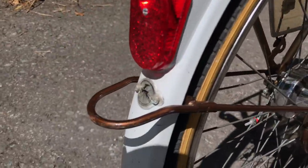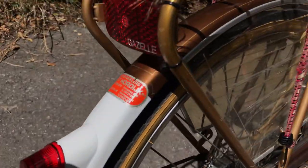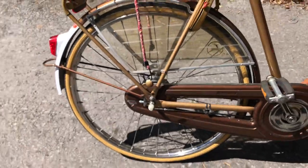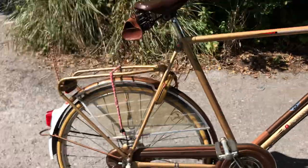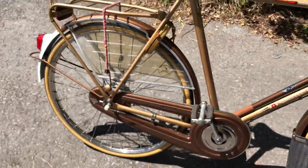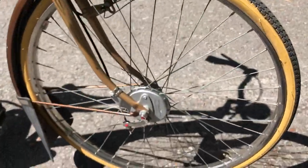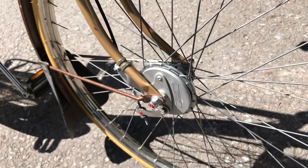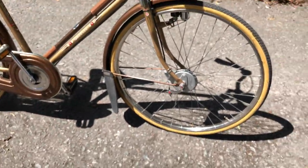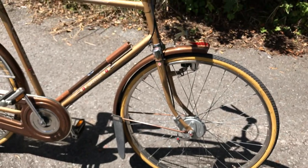There's a little Gazelle on the mudguard where it fastens on, and another little Gazelle there — I could go around all day looking at Gazelles on the bike. Pertinent points: the lock, the full chain case, drum brakes front and rear. That is Gazelle's own brand, copied from a Sturmey Archer but with a slightly different back plate. And you'll notice it's mounted on the right-hand side, which is correct on the Gazelle.